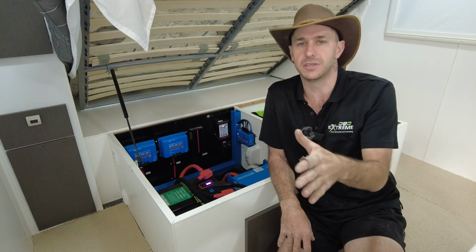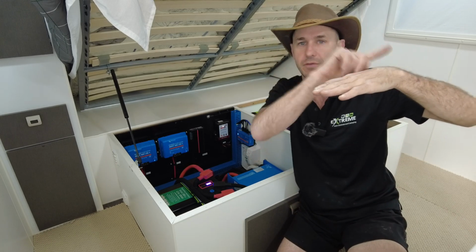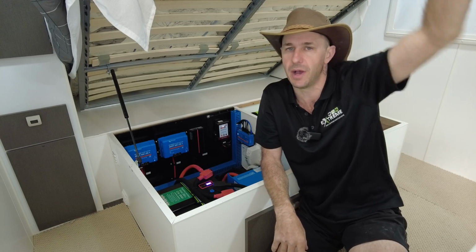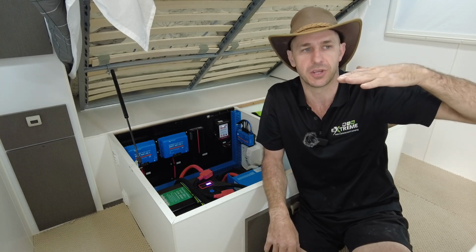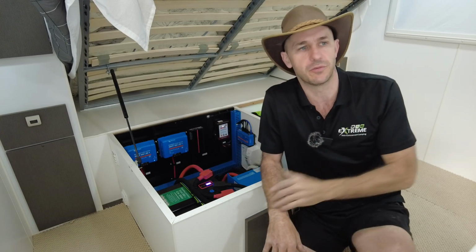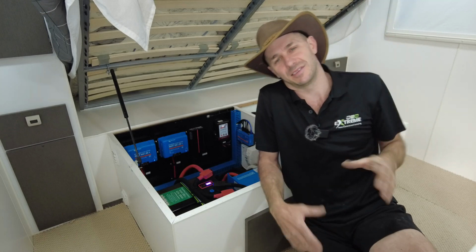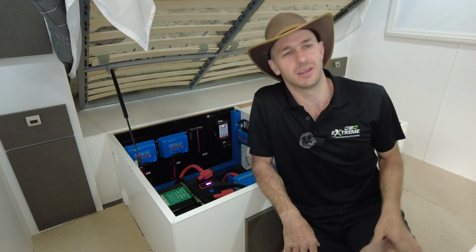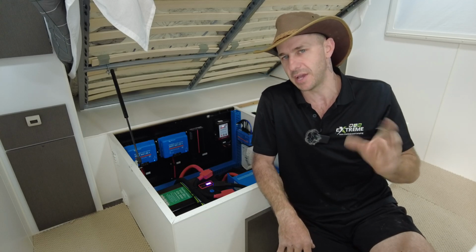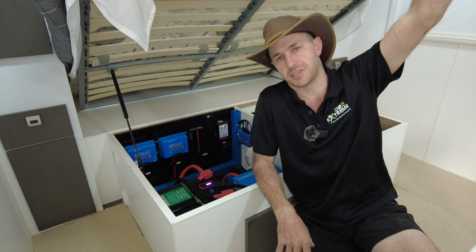Now they are flat mounted, so you're probably never going to see these big numbers for the whole day, 6 to 7 hours. You might see it for an hour or two when the sun's directly above. With flat mounted solar, you can't change it. You're not going to put it on a tilt system. It'd be good if we could, and some people do. But it is what it is. Flat mounted, you're probably going to get maybe 1,000, maybe 1,050, which is what we saw in this. Anything more than that is in the peaks.